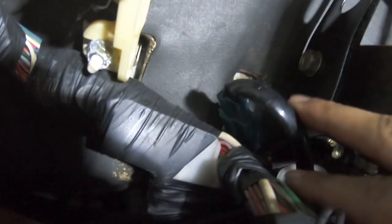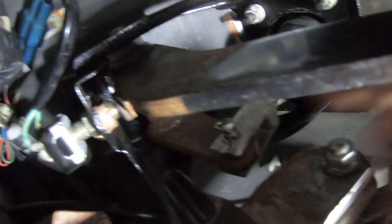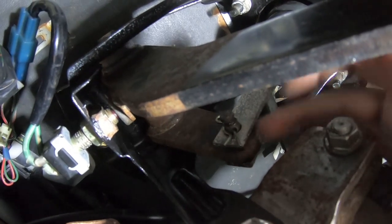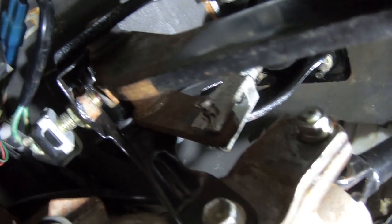This is the plug for the brake light switch. It was kind of tight to get to. I've pushed it about as hard as I can but I didn't hear it click, but I've given it a tug so I think it is in place. And then obviously this is the split pin here, so that's all done. I had to push this down quite a bit to kind of get it over and around, but I hope that doesn't cause any damage.